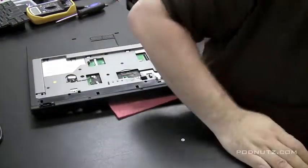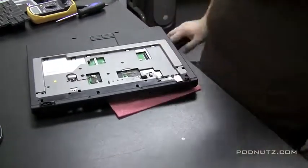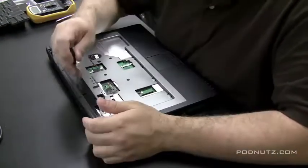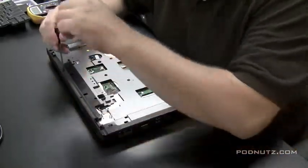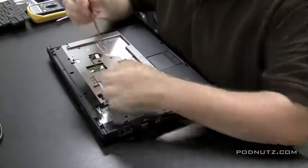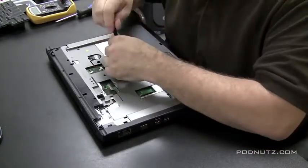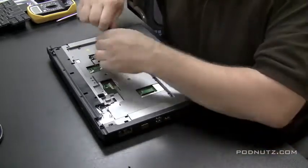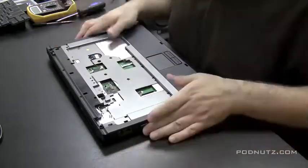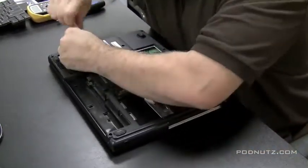On this computer I'm tossing the screws into a pile, because they're all labeled — you can tell the size of each screw by the label next to the screw hole, which is great. A lot of Dells and Toshibas do this. Now the screen is off, so we're unscrewing every screw holding the top plate and bottom plate on to get to the motherboard. The power jack is hidden between the two covers, so we have to remove them.